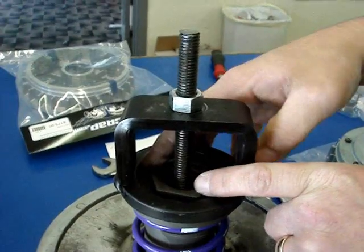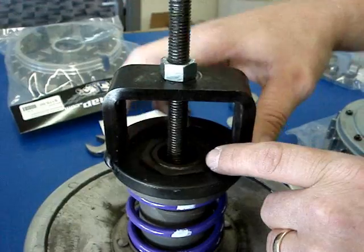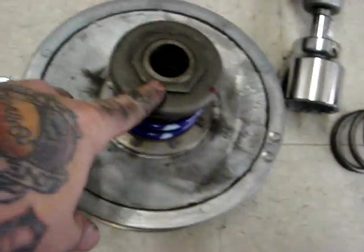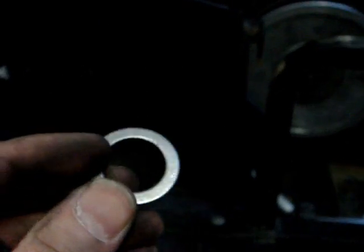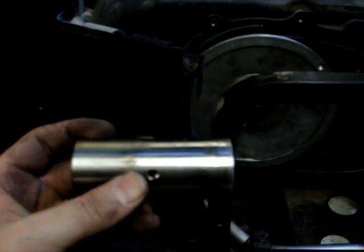Using your fingers, finger tighten the first two threads onto the secondary. Remove the tension from the secondary and install it back in. Before reinstalling the secondary, make sure you tighten the nut that holds the secondary spring on. Reinstall the secondary clutch back into the motor. In this specific car it needed a new belt, so we're going to install a new factory Yamaha OEM belt. When installing the belt, make sure that the arrows on the belt point to the back of the vehicle. Our 660 model gives you a little shim to space the two sheave halves apart. Install this on the clutch shaft first before you install that metal collar that you took off previously.